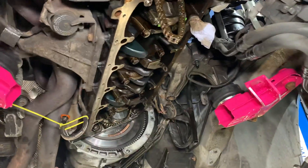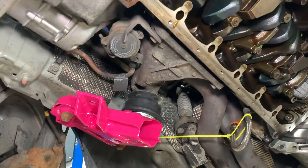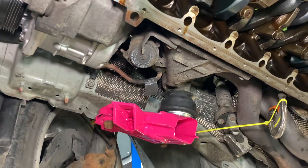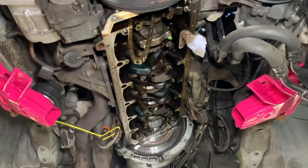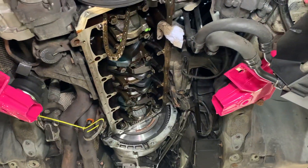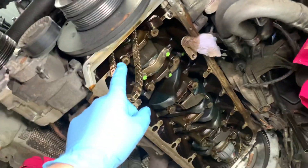We then install our special tool subframe — one we bought years ago and cut the middle section out of, giving us a left-hand side and a right-hand side, which we call our special tools. That allows the engine to sit on engine mounts on a subframe and load its weight into the chassis legs normally, so we don't need to hang or suspend the engine from above. With the middle missing, we can get the sumps off easily, and it's very safe for working under when turning the crank to get the conrods into each correct position.